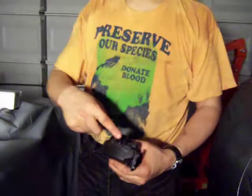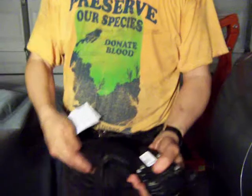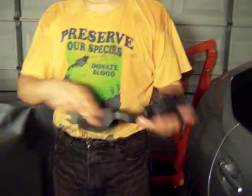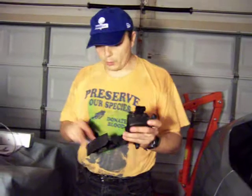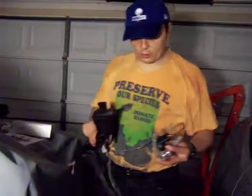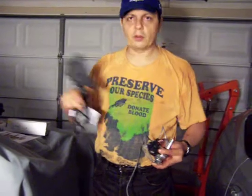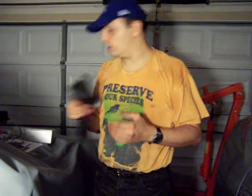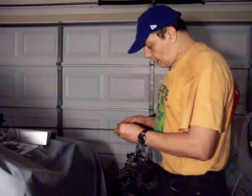Now, as I was reviewing the pedal in the car, I found out that these Nissan cars do not have a cable anymore from the pedal to the motor. Everything they have is electric or electronic, and it goes into the controller. So it looks like I already have an electric throttle in the car, and I have the feeling that I can use it for my system, since it already has all the bolts and everything I need, and it's the pedal. I may just return this if that is true. I like this better just because it's already made for this car and it's ready to go. But we'll see. I'll check with a multimeter and see if the resistance and all the conditions are duplicated by the two of them.